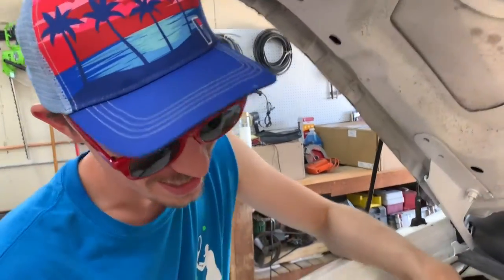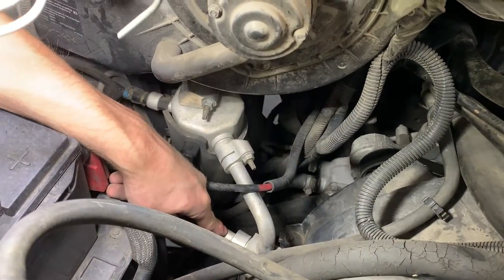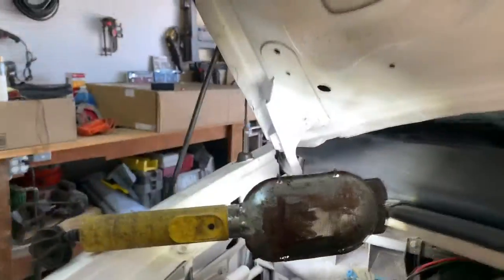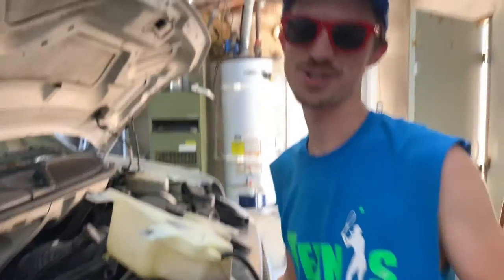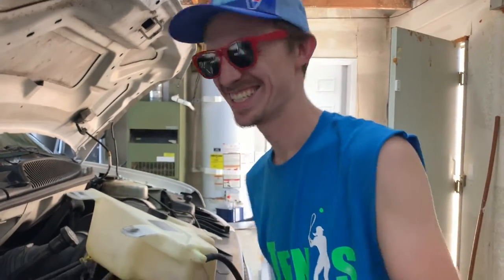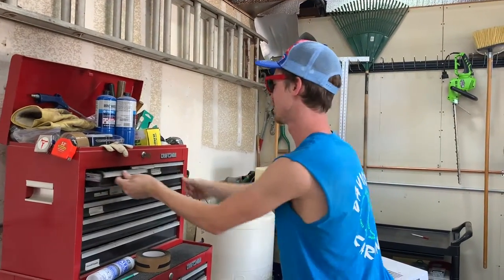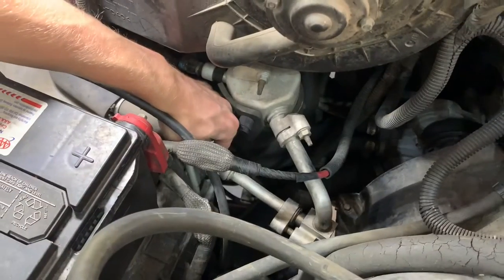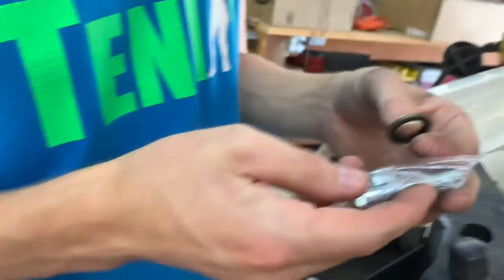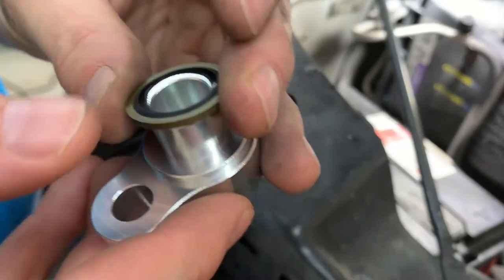For the back return side, I'm pretty sure that's this line right here, so we're going to block off this one. It should be a 10 or a 13 — make sure to drop a comment down below on what size you think it is. Good news: if you guessed 13, you're right and you get nothing. The bag that comes with the kit includes the 5/8 and 3/8 metal-shielded O-rings. The 5/8 is going to go right there for the return side.